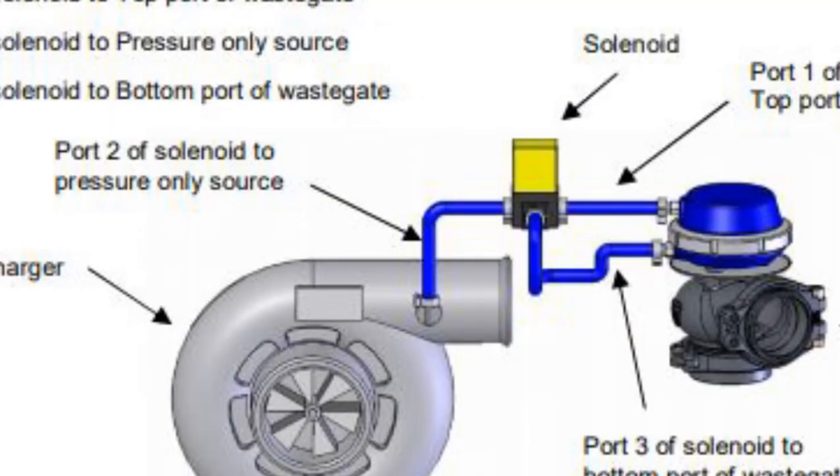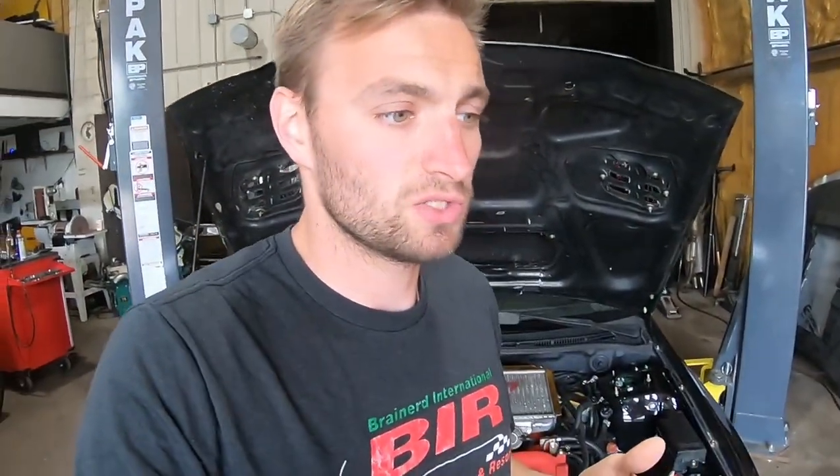As far as the tune went — as we had set the wastegate up, I set it up to have a different option than I normally would. I was trying to make the wastegate sound nice and smooth where it wasn't fluttering — you could kind of tell in the videos where we did a couple pulls and you couldn't really hear the wastegate. But then once we hooked the hoses up just to the top of the gate, it now gets that signature fluttery sound and the car runs great. I definitely have to do another tune — I want to do a 91-octane tune because I want to maybe do a road trip with this car this year. It would be really cool to take this modified car across the country.